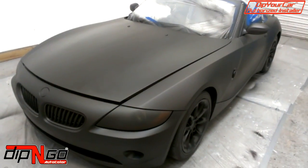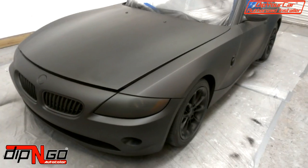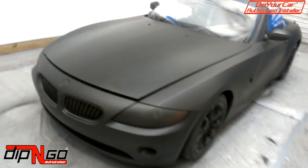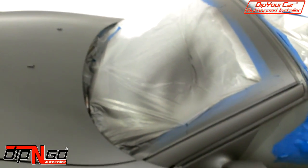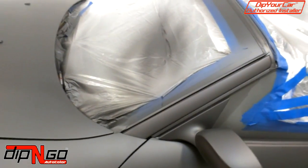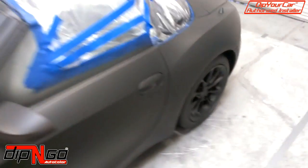Alright guys, we're back again. We just finished coat number 4. Now in between coat number 4 and 5, we do what's called a detail shot. Now the detail shot is designed to get any area that your normal passes are not getting. Now how do you do a detail shot? Well, your HVLP spray gun should have what they call a center nozzle spray or a straight spray. That's where the fan is not fanning and it's just shooting straight.